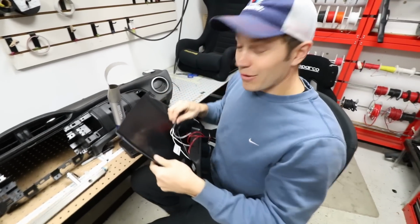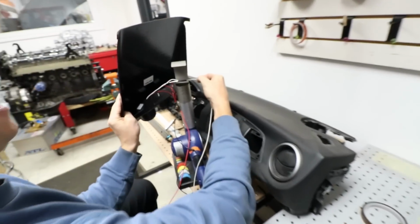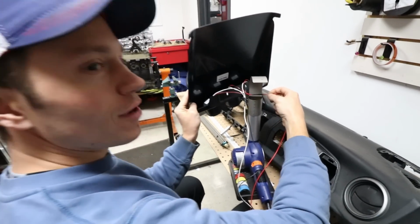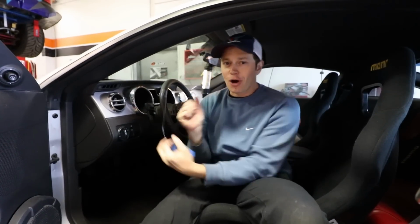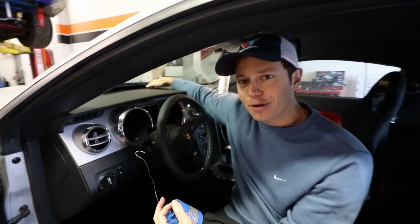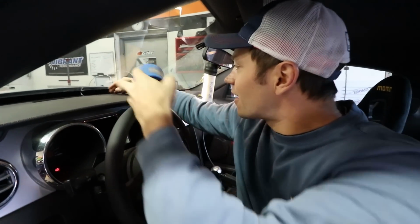And we're back. And we have access to some very fine tools like this heat gun here. So I'm going to use it to my advantage to heat shrink. And with this done, it's time to run the wires through the dash, which I think is going to pose the biggest problem of this whole install. According to AutoMeter's instructions for the gauge pod, we're supposed to be able to fish some wires through the vent back here, and I've tried to do it with a wire unsuccessfully, so I'm going to try something a little bit stronger, which is stainless steel lock wire that Envy has kicking around, and hopefully I can get it through there.